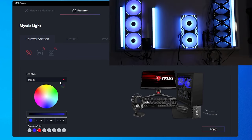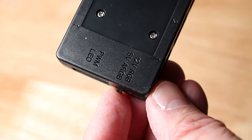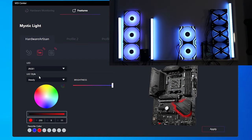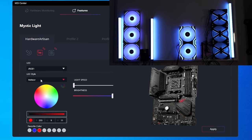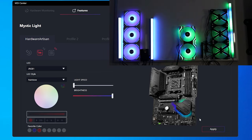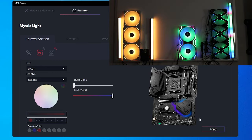Now I'll demonstrate J-RGB 1, the 12-volt port. The hub back there has a little selector switch to choose between 5-volt and 12-volt input. I'll switch it to get its signal from the 12-volt line. Now I've got the 12-volt signal selected — it converts it out to a 5-volt signal for the connected devices. Selecting J-RGB 1 gives all the different LED styles. One thing to note: if we select Rainbow, 12-volt RGB lighting cannot display more than one color at a time across the whole sequence — unlike ARGB, which can show many colors simultaneously. You can see it cycling through colors but only one at a time.